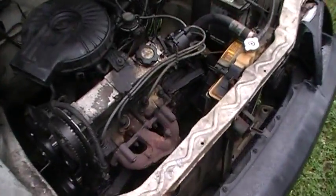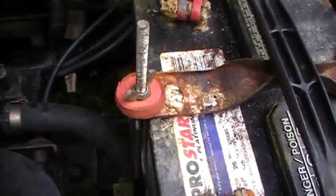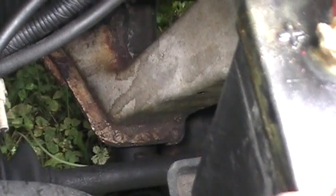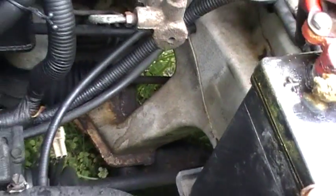You have to get in there with a pick hammer and really beat on them and try to break them and see if they're rusted or not. Driver's side is the one I always see that rusts through, and this one doesn't look terrible. That doesn't mean it's not bad. I'm seeing a lot of white paint, which is the color of the car, with more like runoff rust going on. It's still paint. What you might think is rust in this photo is actually black dirt and a little teeny tiny bit of rust right there. So it's questionable. These may be perfectly good horns.